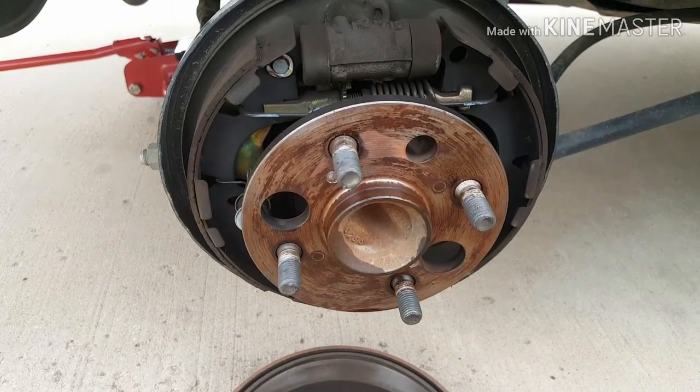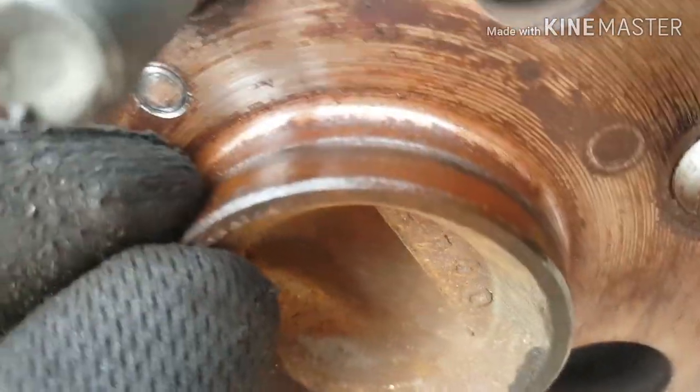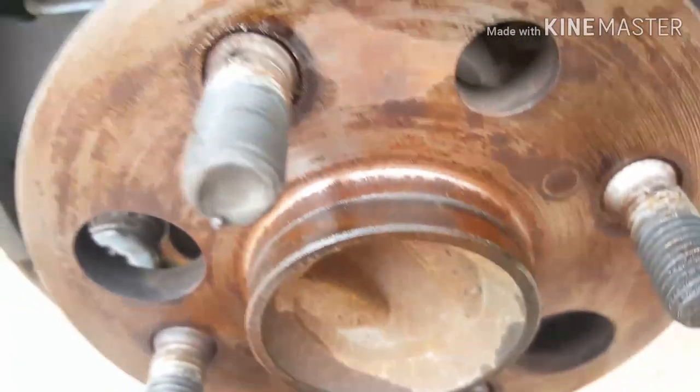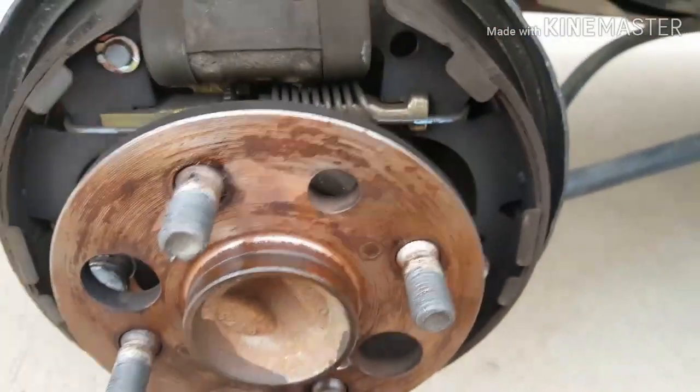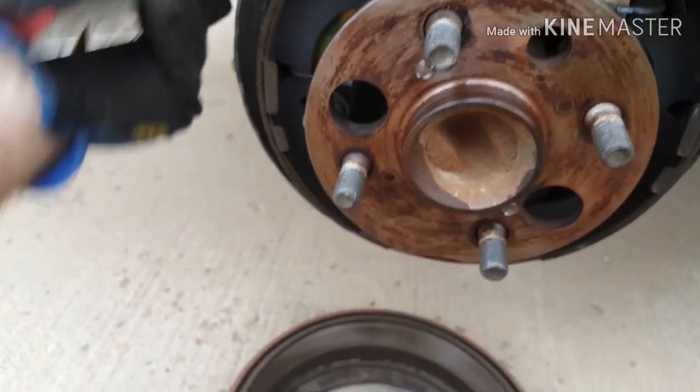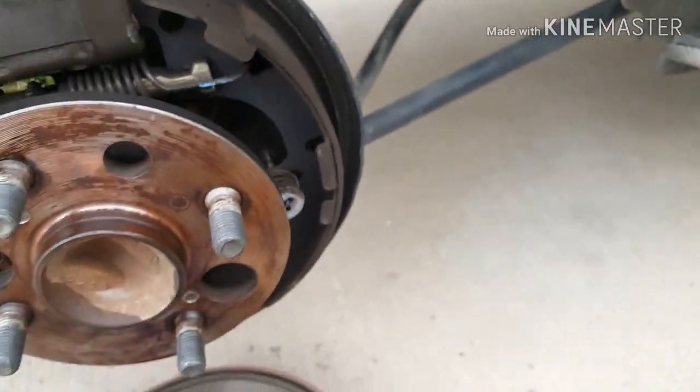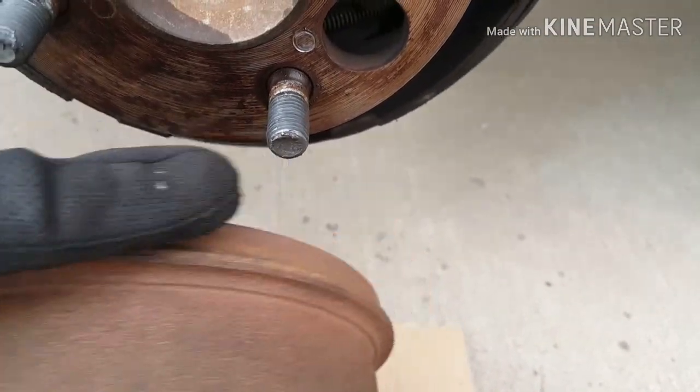The real issue is that there's actually a lip here, and the drum is so tight it's trying to get past that lip — that's what you're pulling it past. I spent probably a good half hour, 45 minutes on this thing. I was taking a hammer to it from behind and it wasn't working. The only thing that worked was using the claw part of the hammer on that lip, pulling hard, rotating an inch, pulling, rotating — and you really have to put some back muscle into it.